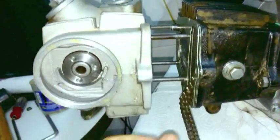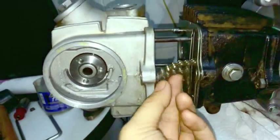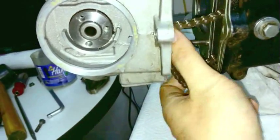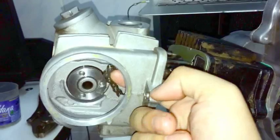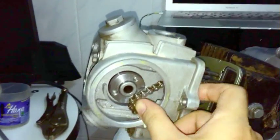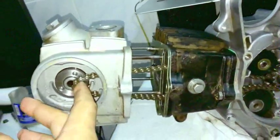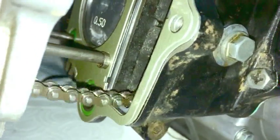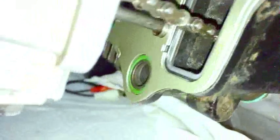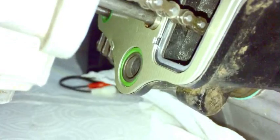At this point, you have to be ready to feed the cam chain. You have to pick up the cam chain, or do your best to do so. How I do it is with two hands, or I can do this with my right hand: you feed the cam chain through like that. You want to hold it so that it doesn't pinch before you push the head all the way down. As I've said, it can catch on the lip of the head gasket, like so, if I let the slack off. It can sometimes pull the gasket off of the cylinder, and if it does that, you can knock the O-ring out very easily. So double check, make sure it's still in there.